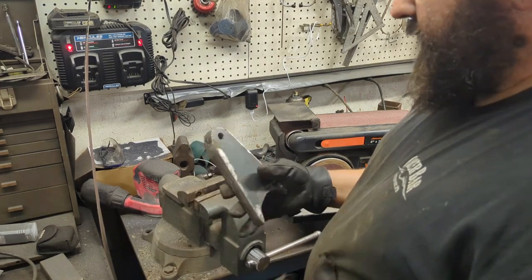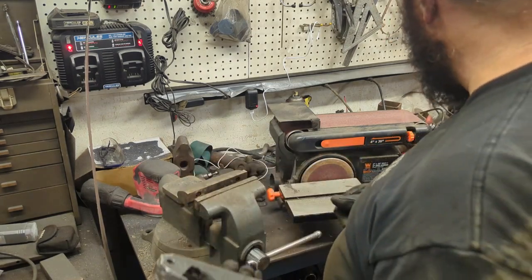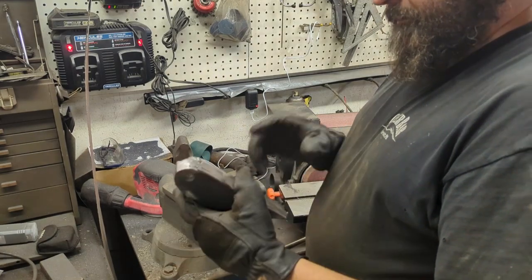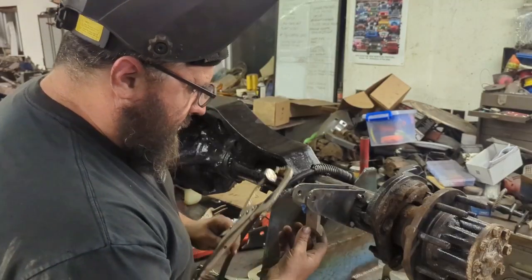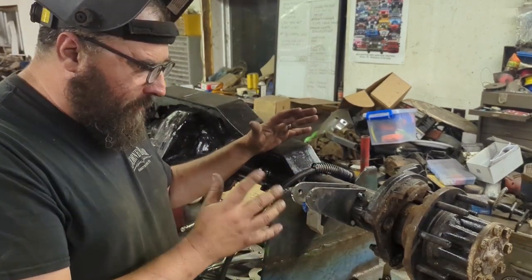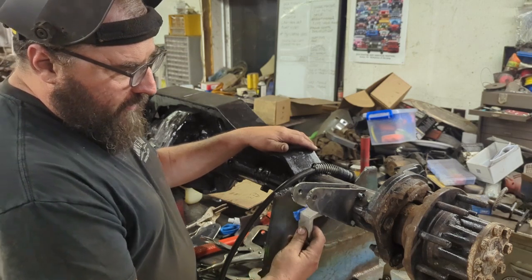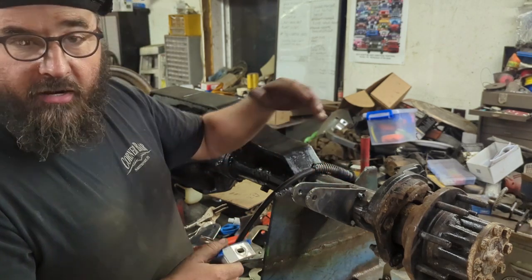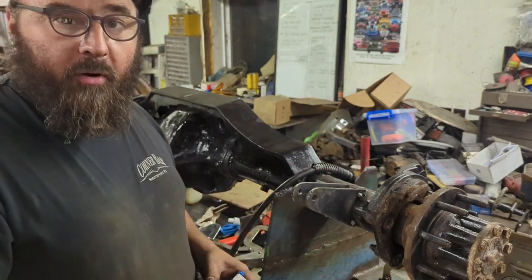They're not perfect, but they're gonna be good enough. I'm probably gonna weld a little bit on a couple of spots just to even them up - that one was cut really bad. I'll mark a couple spots and make them just a little bit smoother, but they're gonna have plates welded top and bottom as well. I've got my brackets all ground to match one another, welded in the holes, ground them up. This is a rock crawler, not a show vehicle. I went ahead and tacked them in place - I found a spacer in the shop of an appropriate thickness so I can make sure my shocks are gonna fit in here later. Now it's time to build my plates top and bottom and then we can burn them all in for good.